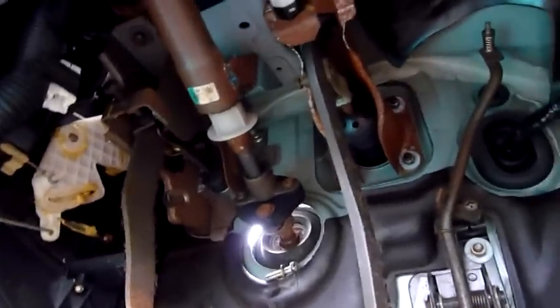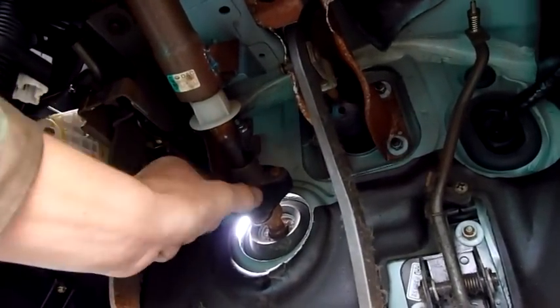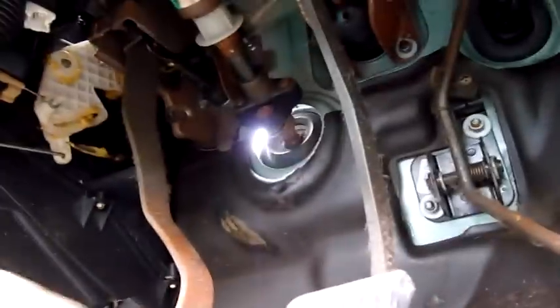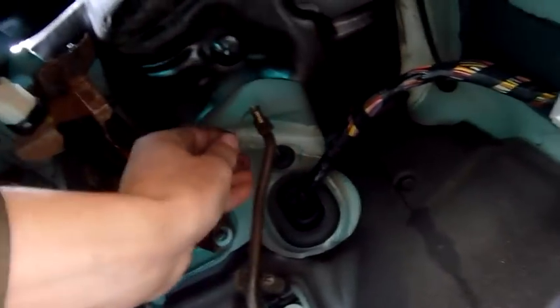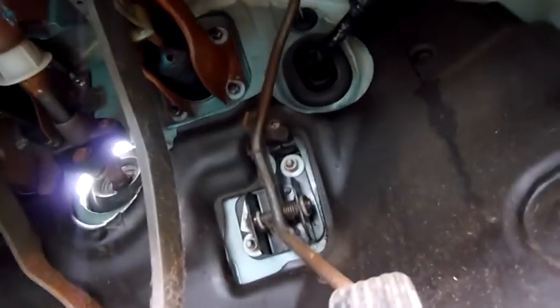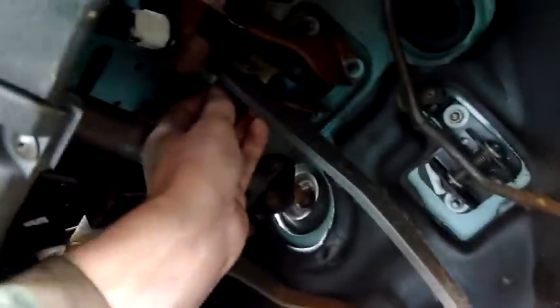Removing the steering rack is pretty easy. There's a bolt that goes through a clamp up here, and there's also one up here which will remove that flex coupling. That flex coupling looks like it'll have a few good uses around the workshop. There's the brake, clutch — obviously not connected to anything — that has to be disconnected. Accelerator cable. Of course everything's disconnected so it's easy enough just to unbolt these and remove the entire assembly. That will release the brake booster and everything after removing that clip — the clip goes through the pin up there, through the rod.